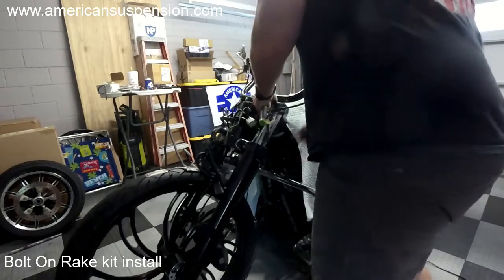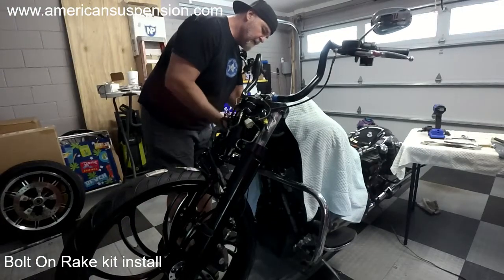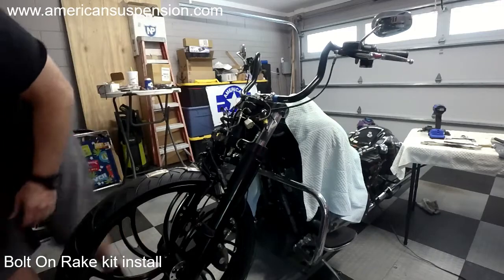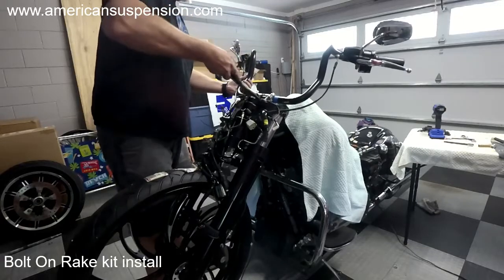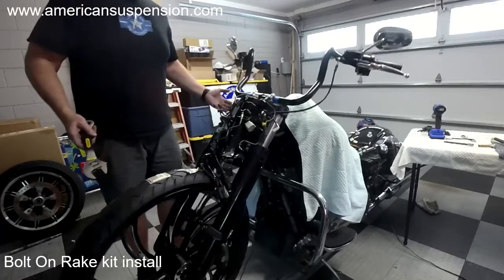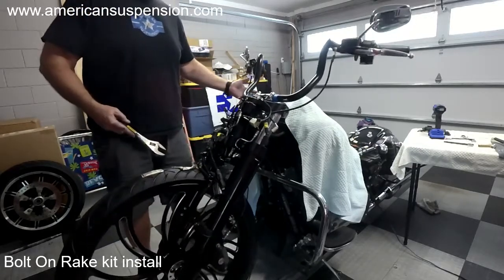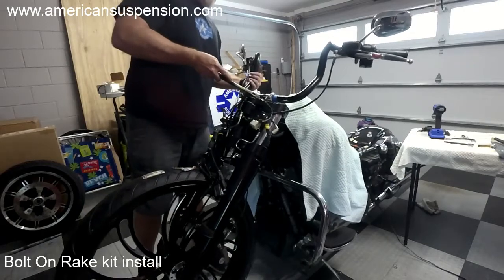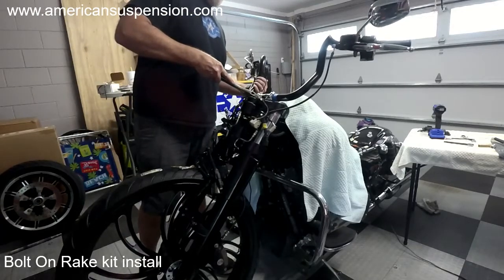So you've got to loosen both sides. Turn in increments. It's moving nice and free still. You see how it kind of slowed down a little over here? Let me go a little tighter and see. So you see how it stopped? It didn't come back. You don't want that. So you need to loosen it just a hair.